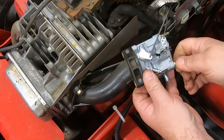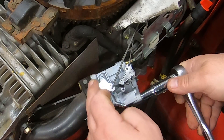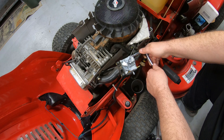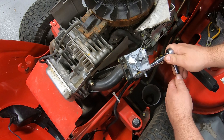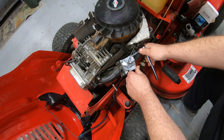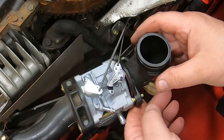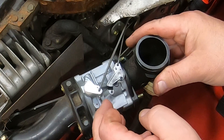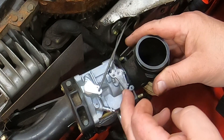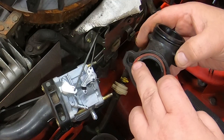Tighten this back down. It doesn't need to be super tight, but tight enough that there's no chance of air leaking in. I call it one-finger tight — probably between 8 to 12 foot pounds, around 110 inch pounds. Once you've got it bolted on, push the intake up on there and verify that choke opens very freely. It should be just as easy to move as it is right now. If your choke is any harder than that, notch it out — that'll be the biggest problem you'll have putting this on a mower.